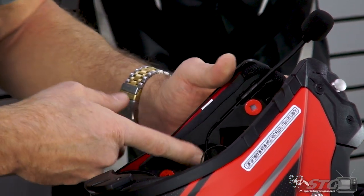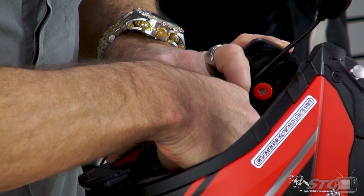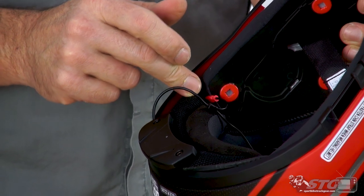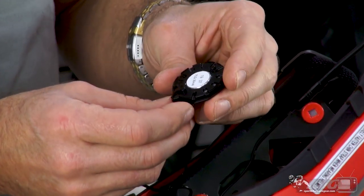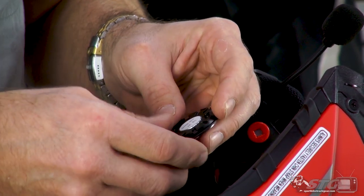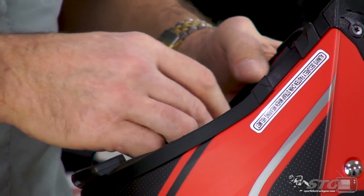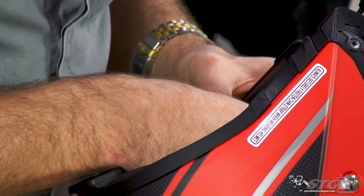Route all the way back until you're into the actual speaker pocket. Route the wire through the remaining channel rearward of the speaker pocket, then push the red connector in between the cheek pad EPS and the rearward EPS to hold it in position while you install the speaker. Looking at the speaker itself, the plastic backing has a couple of tabs — the larger one is on the bottom. Engage that tab with the slot molded into the EPS of the helmet first, then push in on the top portion. I'll be capturing the wire for the boom mic on the back side of the speaker, so install the speaker over that.